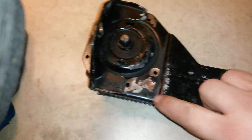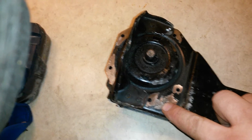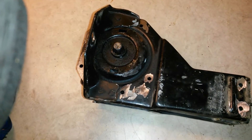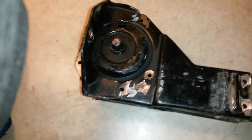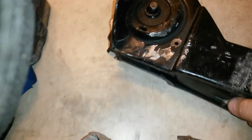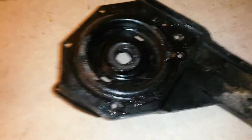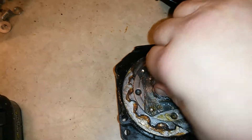What I did was I ground off — there's two pins down here and then there's five up here. Those five there, and then you grind this one down, and that's something that holds a cam bolt or some kind of cam inside the mechanism. I did all that, punched them out with a screwdriver, and then I pulled this off. Everything seems to be in pretty good shape. When I pulled it apart originally, there wasn't much grease in there, so I went ahead and greased everything up.